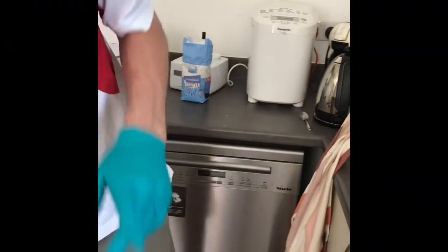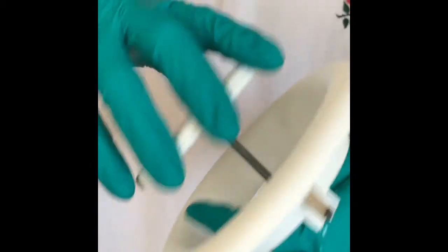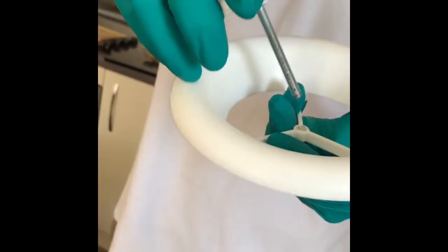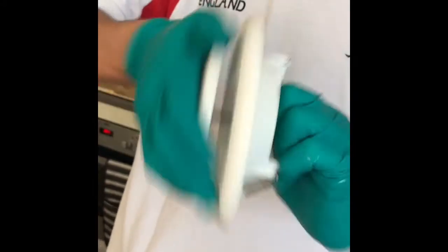Right, that's all nice and clean. I'll show you how to put it back together - it's just the reverse of what we did. Just gently screw that back in, but you can adjust the drum position. You have to be very careful because it's metal going into plastic - you don't want to cross-thread it and damage it. Just gently ease it in. We've adjusted it down a bit further just to get better suction.